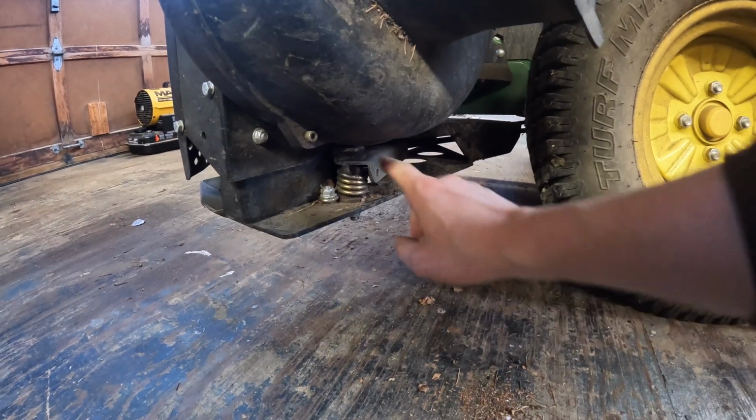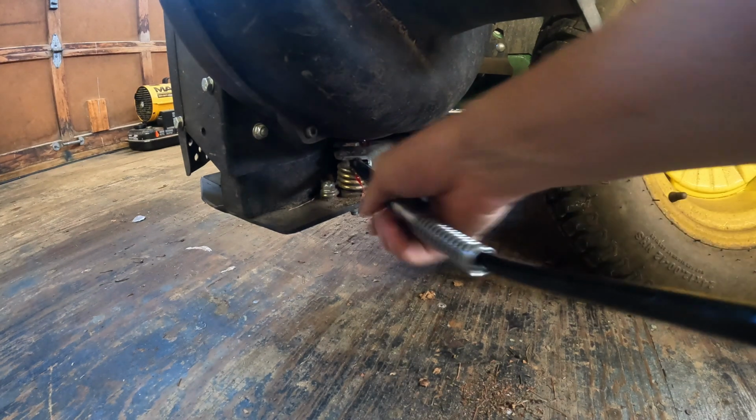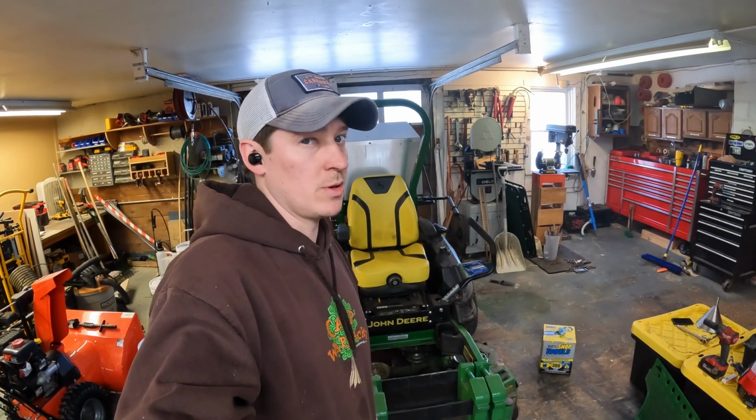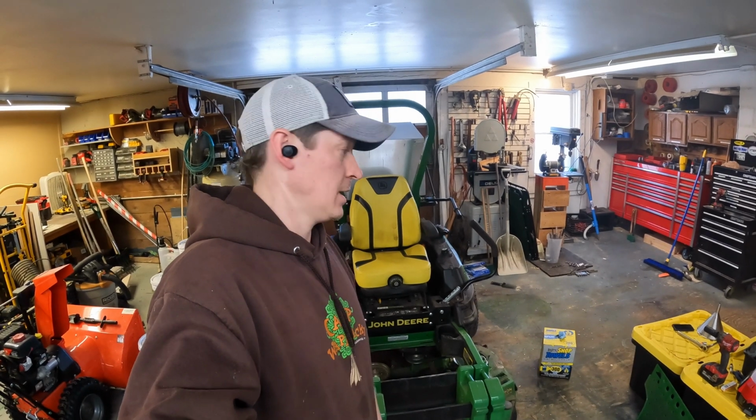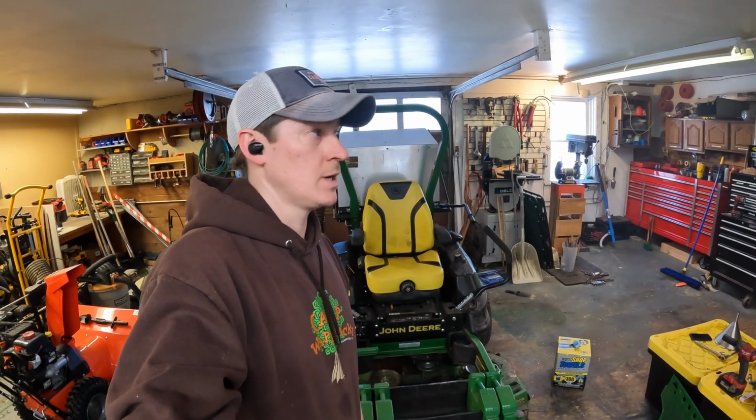One grease fitting, right? Oh, that's good. That's all set. That's ready to go for next spring. I will throw some fuel stabilizer in the fuel tank, throw a little bit of extra fresh gas in there, and we'll be good until late April by the time we can actually start mowing things when things actually dry out, if not early May.